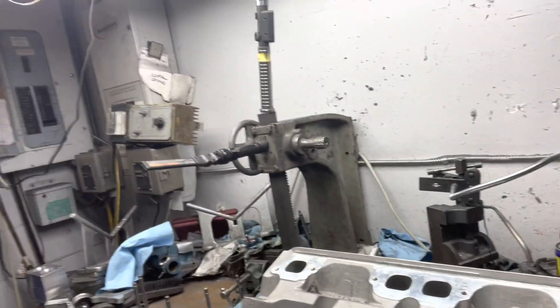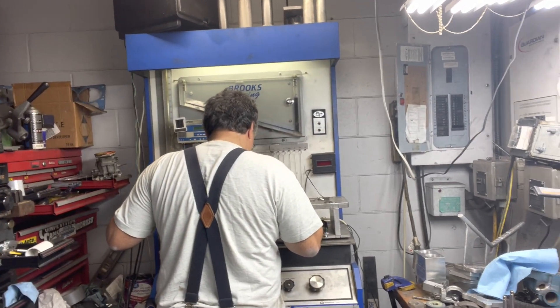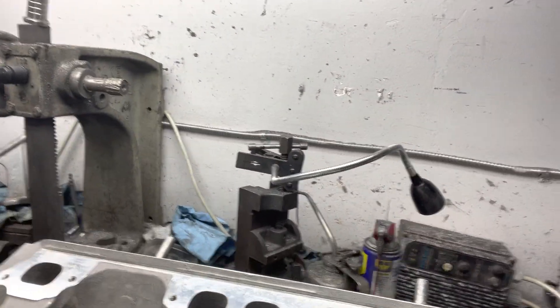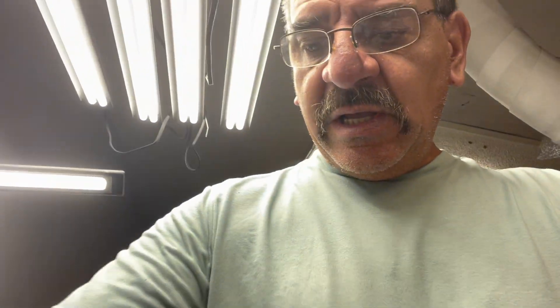Charlie and I are going to put it on the flow bench over here while he sets it up. I'm going to give this a quick whirl and see what an out-of-the-box W5 flows. It'll have 2.216 valves with 3/8 stems. I know everybody's going to say don't use a 3/8 stem, but this is what I have that fits the out-of-the-box casting and that's what we're going to use. Let me get you a quick look at them.